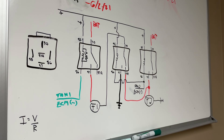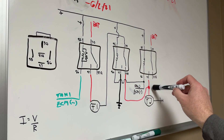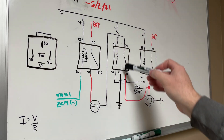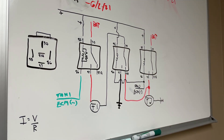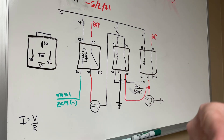Anyway, I hope this helps demystify the three-relay setup and how it works. It's really slick and super easy to do. I'm rewiring my whole setup because I need to go to a thicker gauge wire — I ran 12 gauge and should have run 10. But if you have an existing two-relay setup and want to go to three relays, all you have to do is tap into two wires: the fan two trigger and the power going to fan two. The ground just runs through the new relay and out.